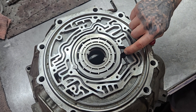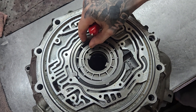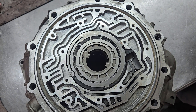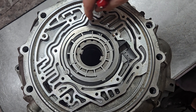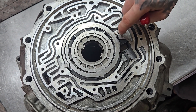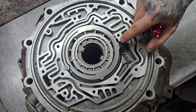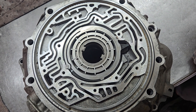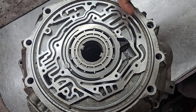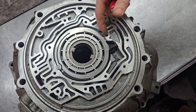I like to think of this like a turbocharger. At wide open throttle, look at how much we can compress that fluid and how much suction this area creates — it's really pulling in fluid and compressing it tight to build PSI. It works with the pressure regulator: when the transmission is satisfied with its pressure, the pressure regulator allows fluid to come in, push against this rubber wiper and the land, and it'll fluctuate. We basically change expansion and compression by altering the fluid flow itself.